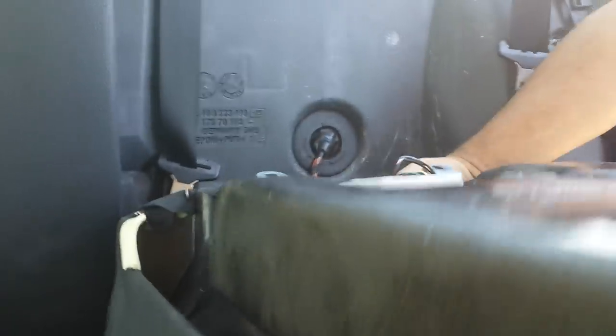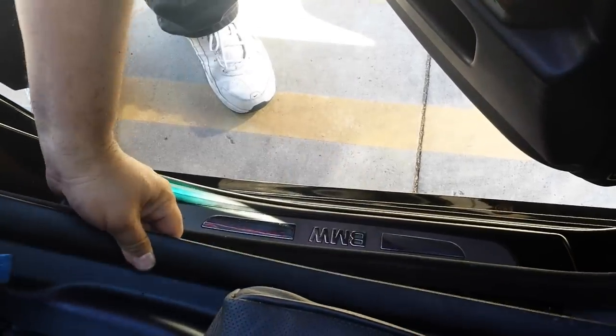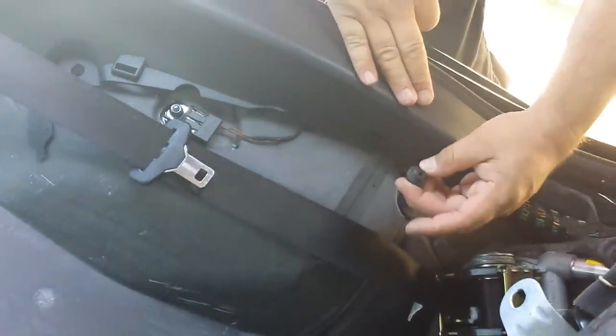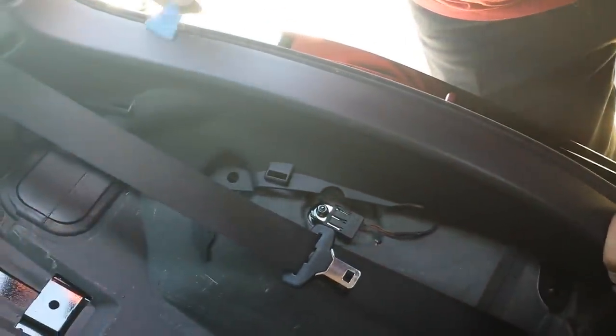Be careful — a wire is hooked up to the seat. After that, remove the two plastic nuts, then you can remove the upper plastic cover for the door jamb. Just use the dashboard removal tool to pop that one out and push it aside.